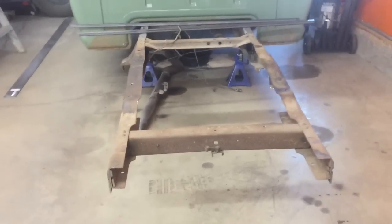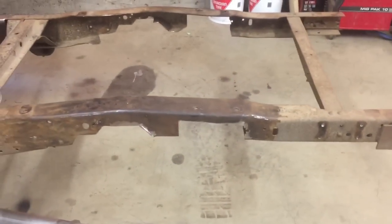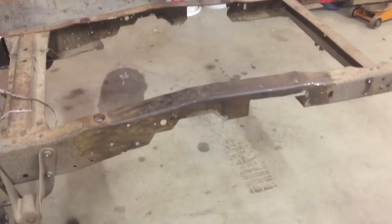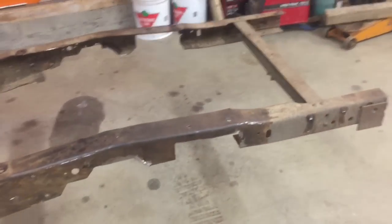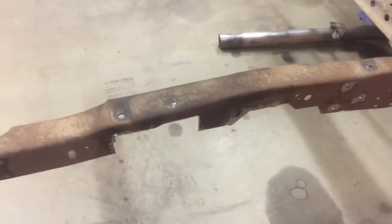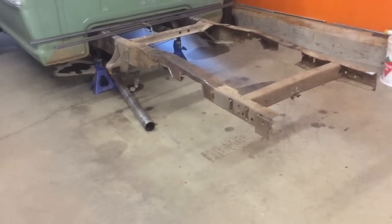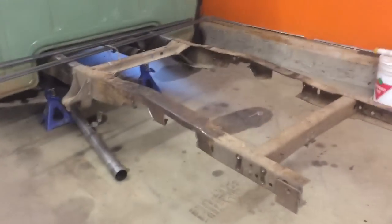Okay, this is where I am at now. I've scribed out the whole subframe like I showed in the last clip and made all my cuts. The subframe actually sits in there just about perfect, so I'm going to go back and clean up everything here, do a little bit of bracing on the inside, a little bit of welding, and then I'm going to bring the subframe up to meet the frame for the final time — it'll get welded into place. I'm cleaning off the subframe so I'll have a nice place to weld, then I'm going to come back in along the inside and box in the frame at least as far as this front crossmember.